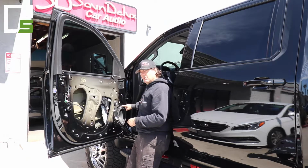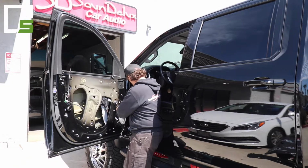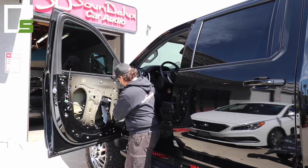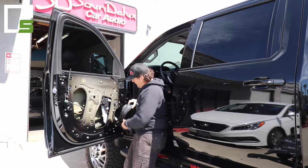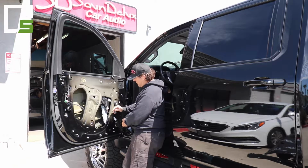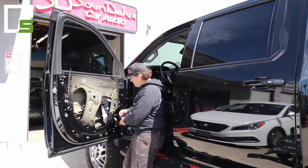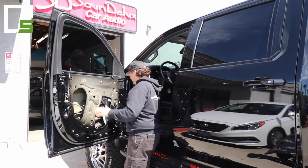Then you have one 7mm screw right here to hold the 6x9 in. You're gonna pull that screw out. It's held in with a little bit of a clip. You can use a panel tool to push down on it right there. It'll pop right out. You pull it out, you got your plug, another safety release on that. Slide back the red, push down on the depression, slide and disconnect that. So now this puppy's pretty much prepped.